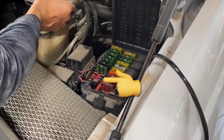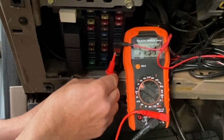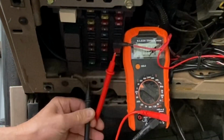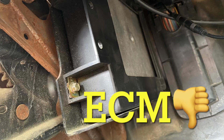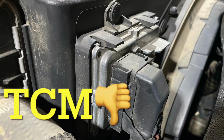You can go through every fuse in the engine compartment or inside the dash in order to find where your key on power is compared to a constant battery supply to pull off of. You do need to be careful if you are going to try and wire it in this way by checking your fuses for key on power, because I'm not a big fan of pulling off anything that is running another computer, just in case that extra amperage draw messes with that OEM wiring.